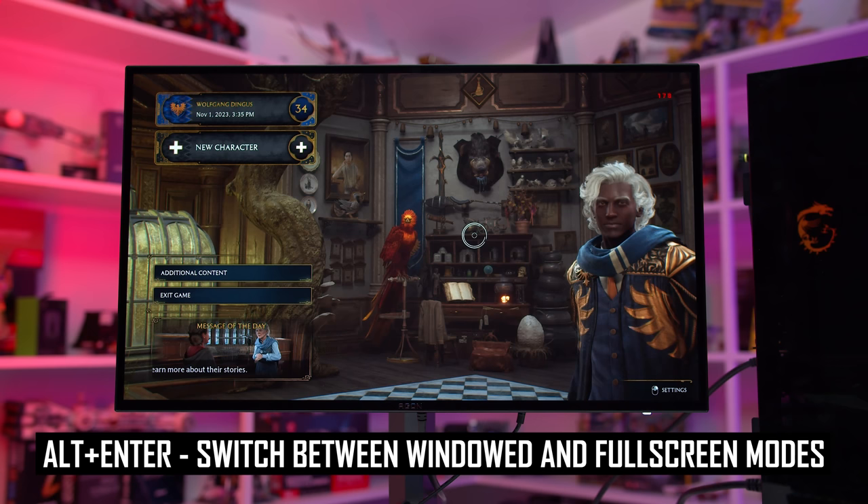If you're wondering about bit depth — whether you should set your monitor to 8-bit or 10-bit — this doesn't typically make a huge difference on most monitors that use native 8-bit panels. My preference is to use a higher bit depth where possible, but only if that ensures full RGB colour at the highest refresh rate and resolution. This can be checked in your GPU's driver software: turn the bit depth up, but make sure all the other elements are preserved at maximum quality.